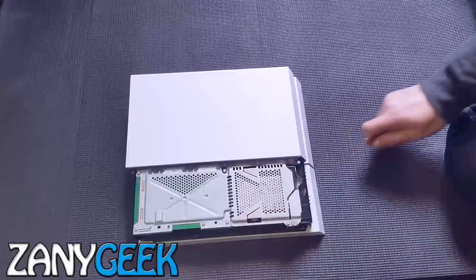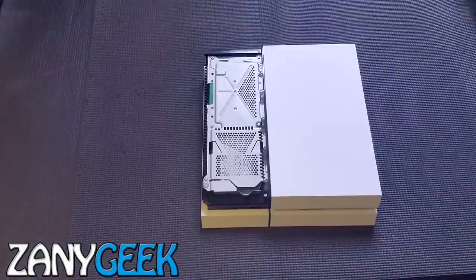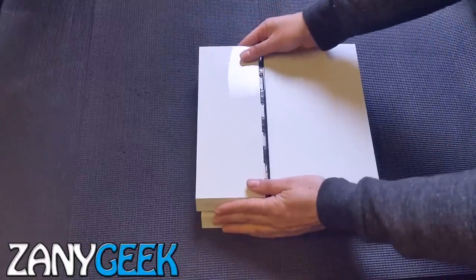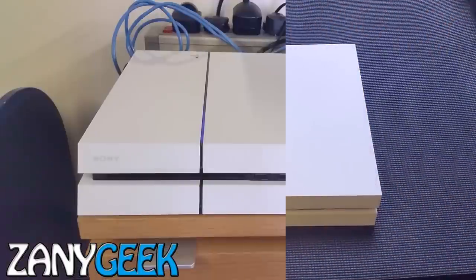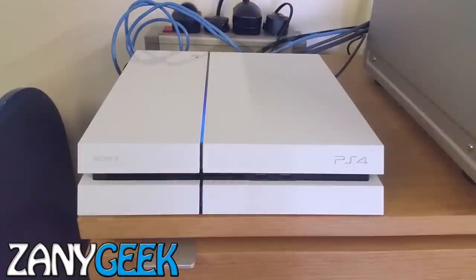It has not reoccurred since we did this, and I reckon it'll do the same for you. You just want to tighten it until the screw bites — you don't have to go hard on it. Then simply stick the cover back on, and hey presto, you have a PlayStation which will not spit out your discs.